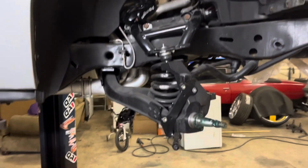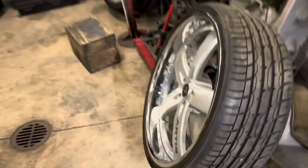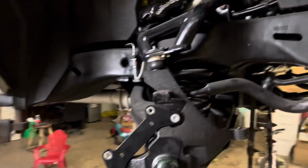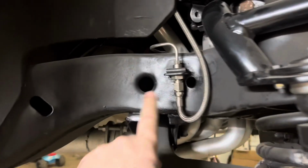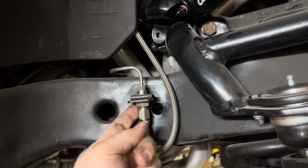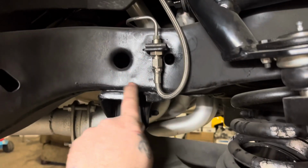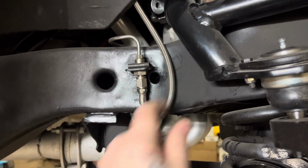But anyways, all right, y'all, Bankroll 10, trying to get these fitted on here at a nice height. I have to do the frame notch, so I gotta trim the plastic, all that, you guys know. But I'll film that. They had put this tab on here real nice on the brake line, so I gotta cut this tab off the back, which I think they only got a couple tacks on there, but I'll work at it, I'll get it off, and then I'll tack it back on because my notches go up into here. So I'll put this tab right back over here.